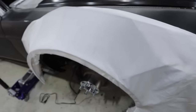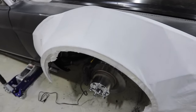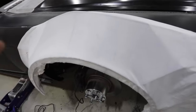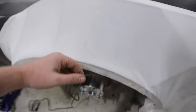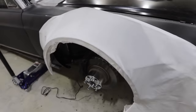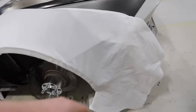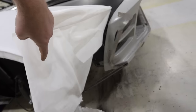So we're gonna try the tape method next, which is just like it sounds. You just run tape straight, and you just have to make sure you're not running a piece of tape at a crazy angle, but just run it straight like this, work your way through. All you need here is to have a structure, something that will hold the weight of the fiberglass and hold it in place so you can get some resin on that fiberglass, and once you get your first layer of fiberglass to dry, you're good enough to keep working. So we're gonna go ahead and try and work through this with tape. We still haven't gotten to the very, very complex angle that is that, so tape, I think, is gonna be our friend here. I hope.